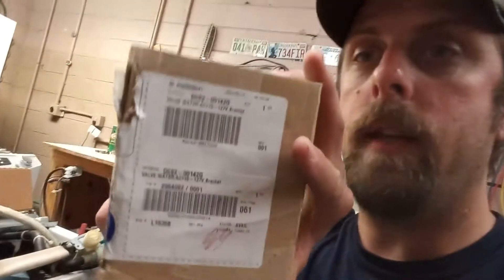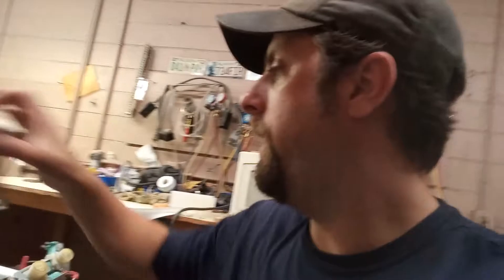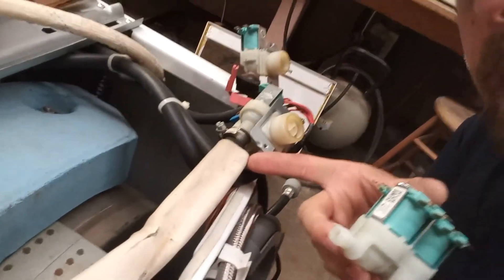There is a retrofit for what will come up as the NLA cold water valve. The cold water valve is this Samsung valve right here — it is DC62-00412G. As you can see, the configuration of the valve is a little bit different than what we've got here.